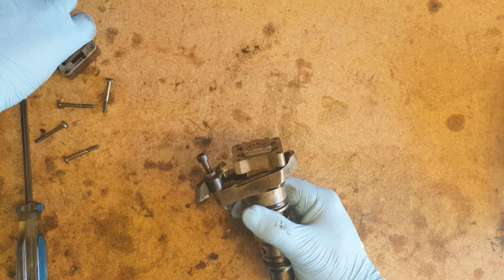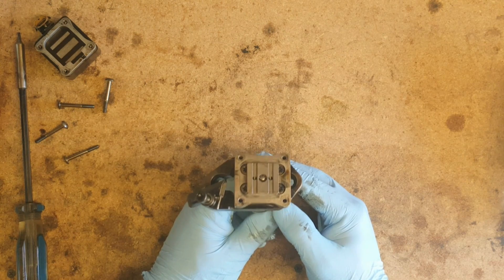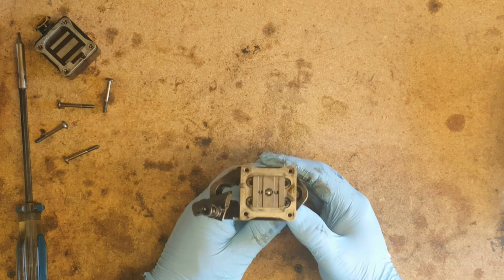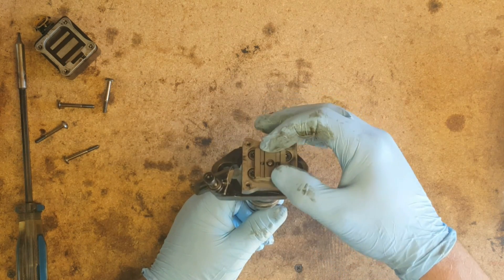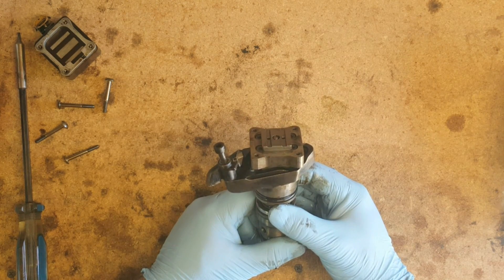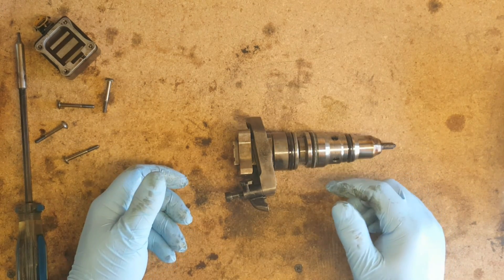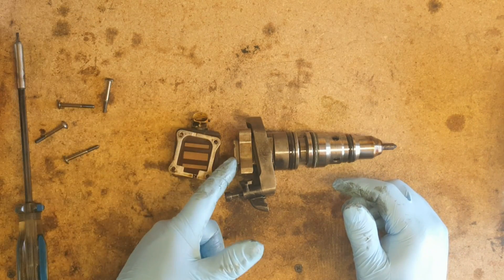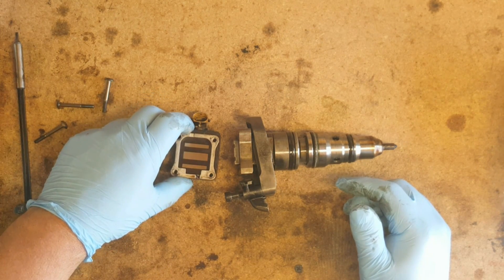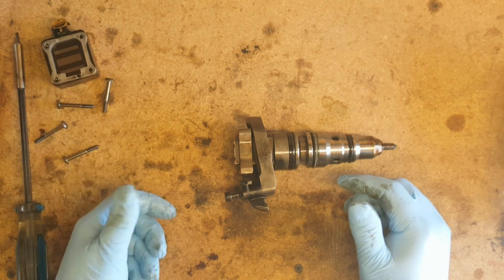So if you're experiencing the symptoms of a cold misfire that clears up pretty suddenly as the engine warms up, there's a pretty good chance that's what you've got — a worn lower poppet seat. They can be shimmed; some people don't recommend it, but I don't see any big problem with shimming up the armature plate a little bit. You just have to be careful not to over-shim it, because if the armature plate contacts the solenoid itself, you'll start throwing electrical codes from the IDM and it will probably shut down the whole cylinder bank because it thinks it detects a short.